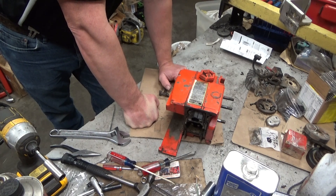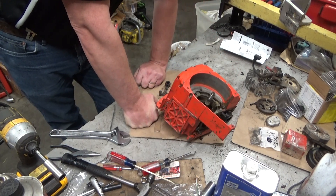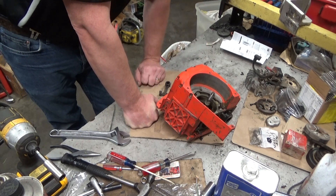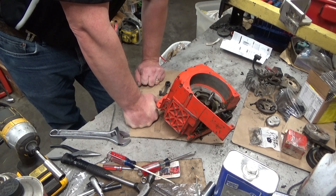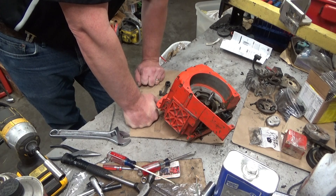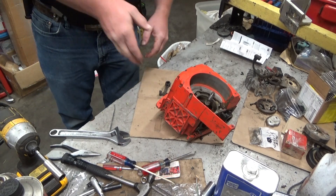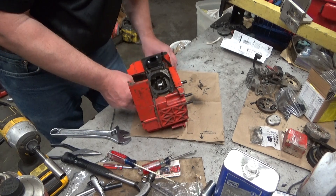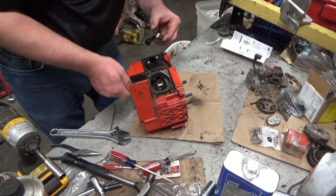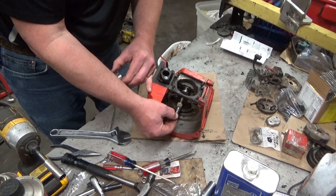So Al, we'll have to decide if you want to go ahead with this or not. But as I feared, we're looking at crankshaft bearing and building it up from there — new rod, new rod bearing. There's not a lot to be saved on the engine here, in fact next to nothing. It's whether or not we can find some parts at a reasonable price. So folks, it's unfortunate when one comes up like this, but pay attention to those signs: dull bearing surfaces, excessive play. A little bit is normal — that is not.